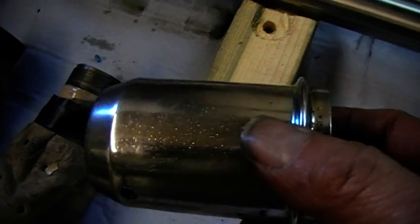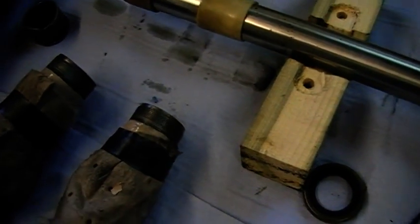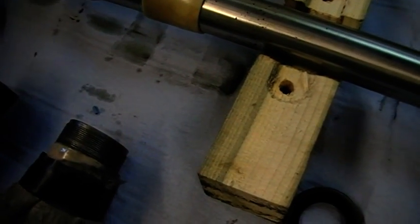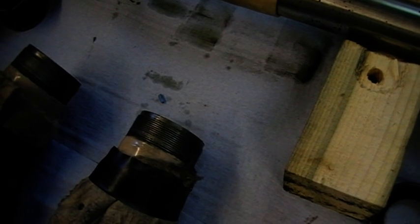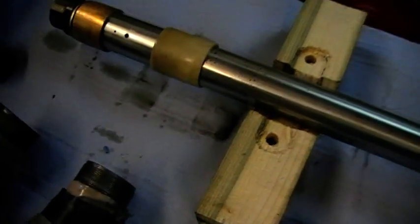I mean, some people put thread sealant on. Yeah, you can do, but you'll never ever get these things back off again. I mean, I bought a new pair. They're sort of £80, and I don't really want to do that again. But they're fiendishly hard to come off. I've made myself a special tool as well for putting them back on. I've got a big spanner picked up from an auto jumble, flattened the edges, drilled it down, tapped it and put a couple of Allen bolts in to do up the seal holder.